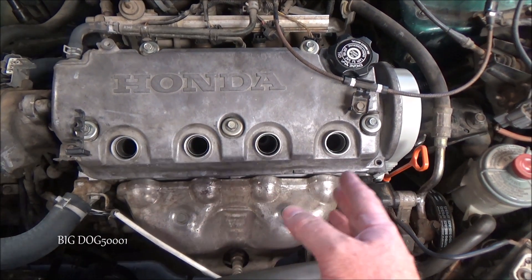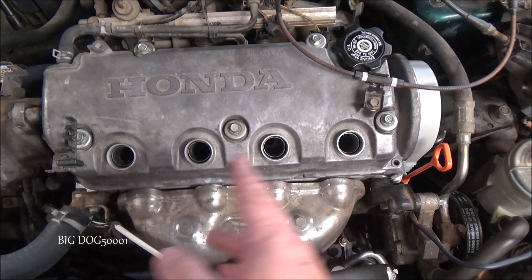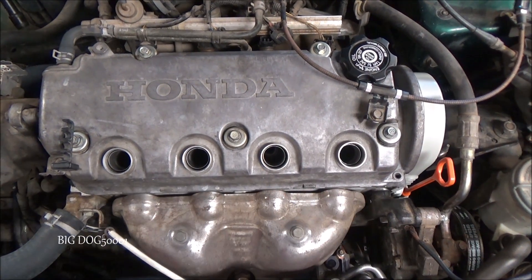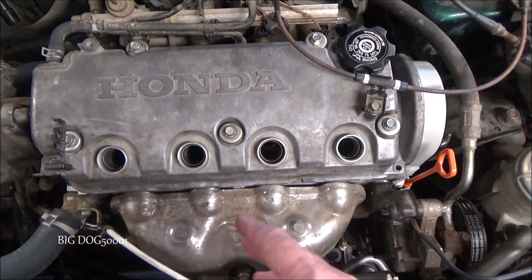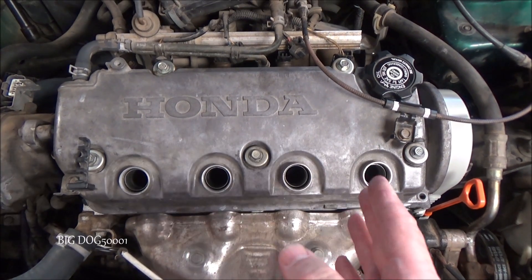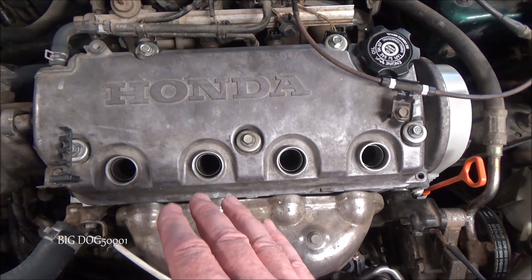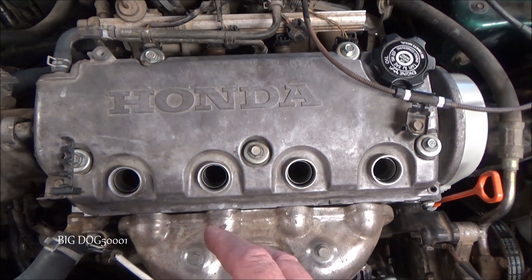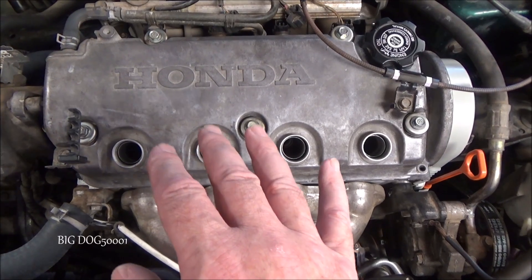They were all fairly close. Considering the age of this engine and everything it's been through, that's not too bad. The generally accepted rule is we don't want more than 10% difference between cylinders. Our lowest was 150 and our highest was 162 — a variance of about 12 PSI. Ten percent of 150 or 160 is roughly 15 to 16 PSI, so we're inside that. Honda's spec on these engines is no more than 29 PSI variance, and we're not even close to that. The minimum we want to see is 135 PSI, so we're above the minimum. If this engine were brand new, it would probably be around 180 to 185 PSI. Considering how old this vehicle is and everything it's been through, the compression test is actually pretty good.